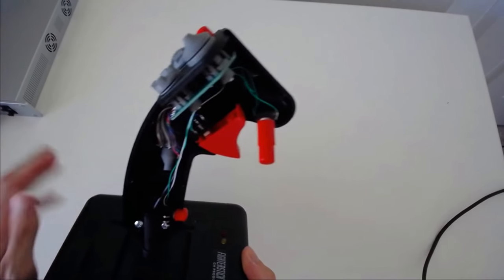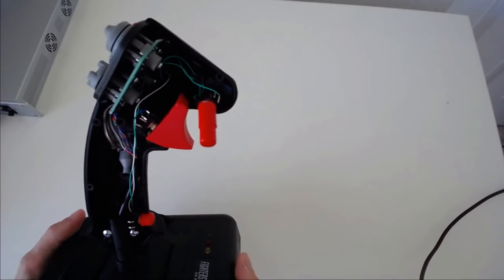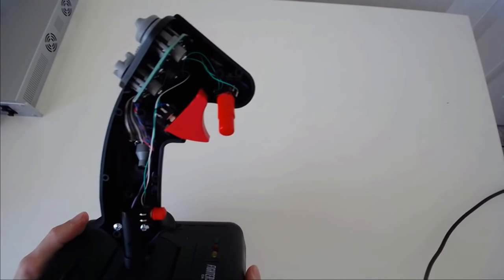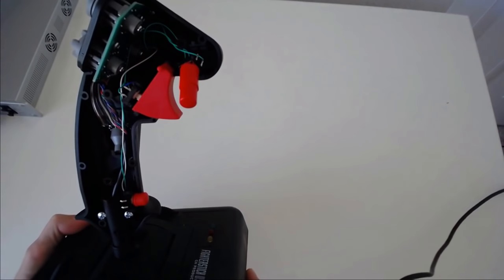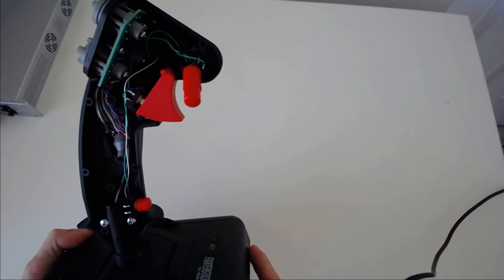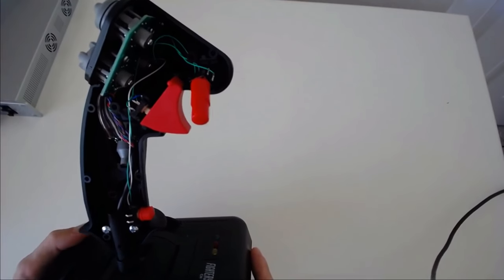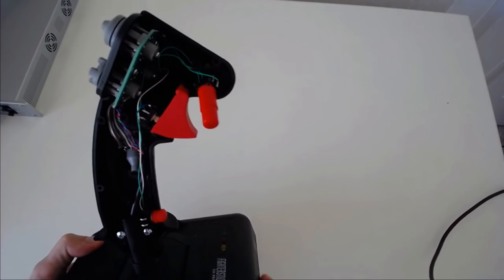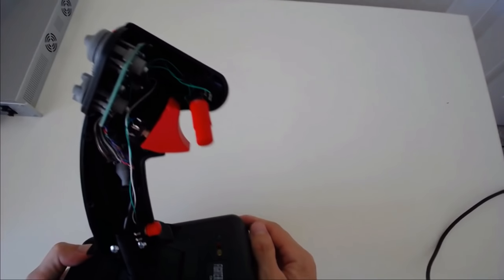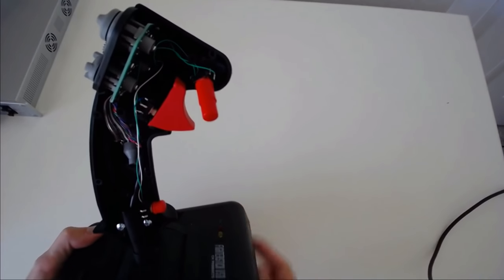In more absolute terms, I don't really consider that superb. I just consider that what everyone should be using. It's really more of an embarrassment that you don't see everyone using switches that are rated to 10 million cycles, because the difference in price over this entire product, you've got four tack switches on this, you're probably adding like 80 cents to the entire cost.